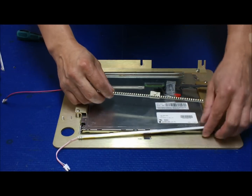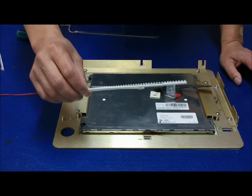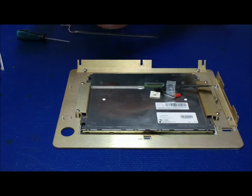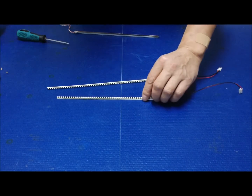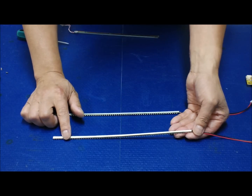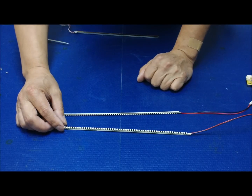We're going to use the UB series. The UB is not going to fit inside this reflector, so we are not going to use the reflector. We have to mount the LED right back inside the assembly without the reflectors. All our UB36 units come with what we call silicon housing. You have to remove that cover and then slice it in and mount it right on the top and bottom. I'll show you that later.